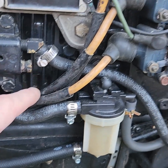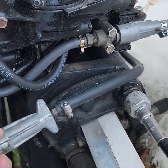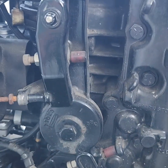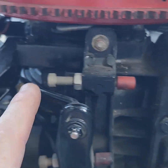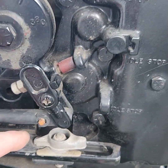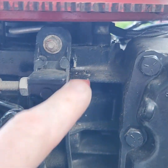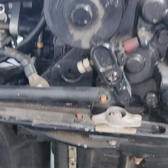The fuel pump I don't think has been changed. All the fuel lines have been changed. He still had the original fuel adaptor — the twist grip one. You can see as we walk around that this has been not too bad. There's a couple of things I noticed right away. The maximum spark advance looks like it's been backed all the way out to try and get max power or something out of it. So we're gonna have to do a full sync and link on this too.